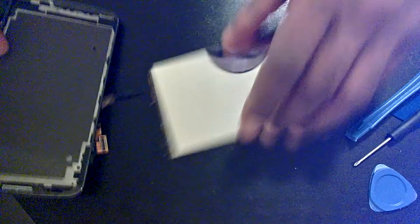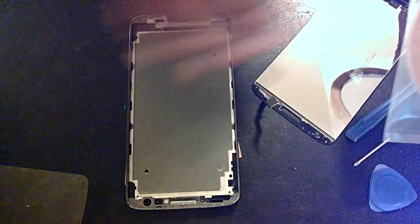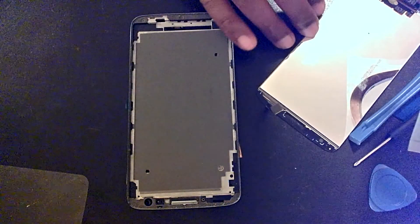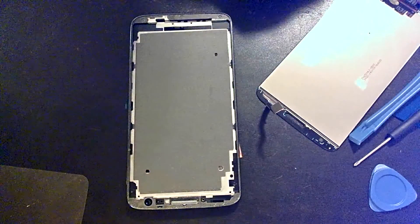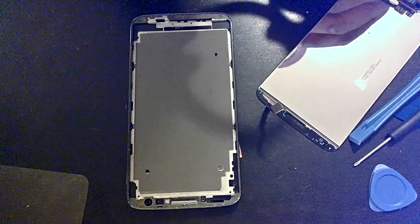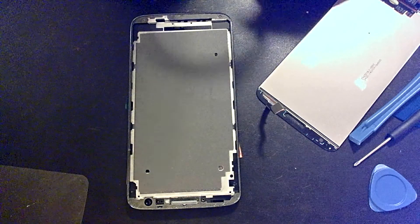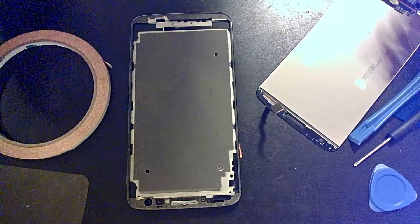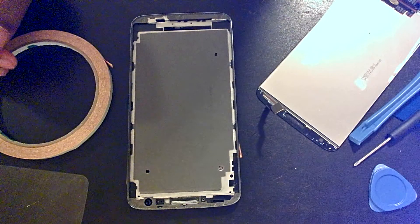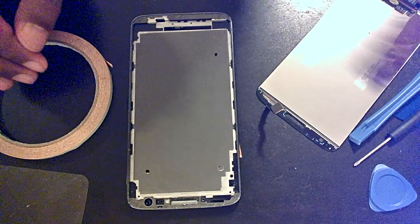If you are replacing your screen, don't do what I did — make sure you pick up some adhesive, fix it along the edges, and place the screen inside. But test the screen before you apply the adhesive. Mine works, so I'm good to go. Make sure you do some testing before you fully assemble your phone, to avoid any further issues. Putting the phone back together is pretty much just doing the reverse of what you did to take it apart. I did it once and the second time I had it down from memory — it really wasn't difficult, just a little time-consuming. If you have any questions, please leave a comment and I'll do my best to get back to you. Thanks for watching.